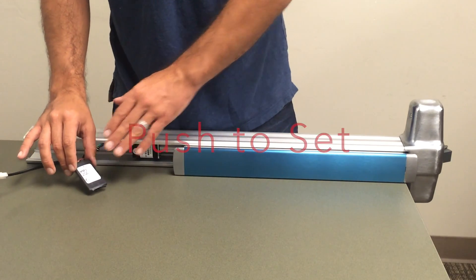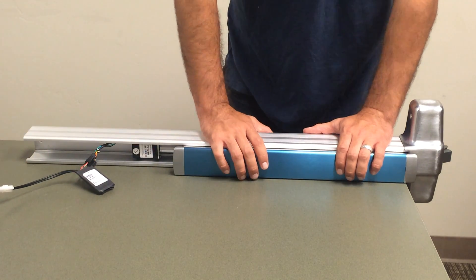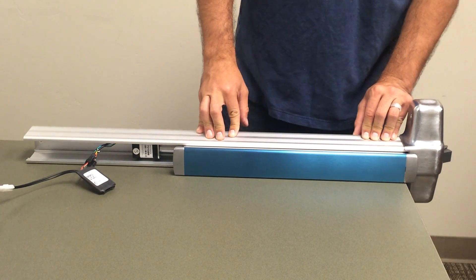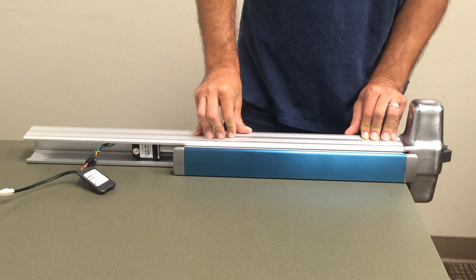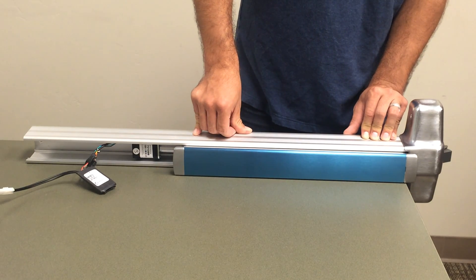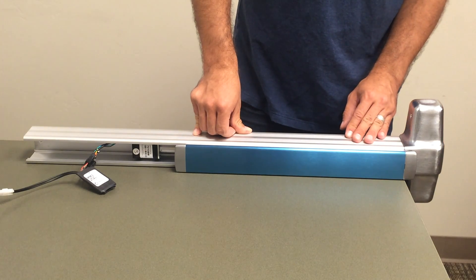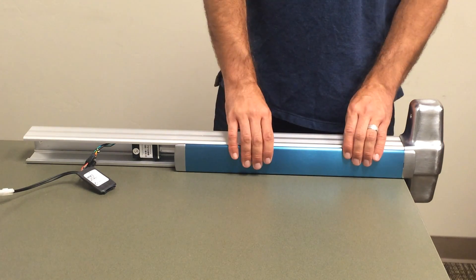I have the module out of the device right now for demonstration purposes, but you would not need to take off the end cap or filler plate in the field. We're going to start by showing you a device set incorrectly, so we're going to see it retract and the latch bolt is hanging out — that would be caught up in case you have a vertical rod bar.